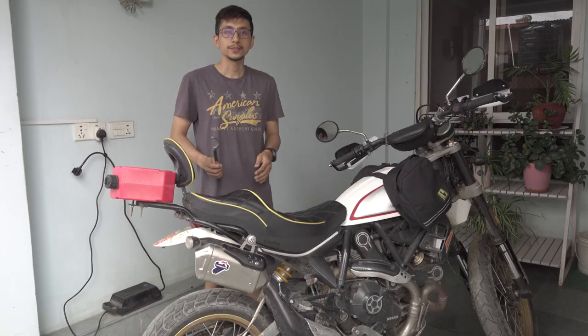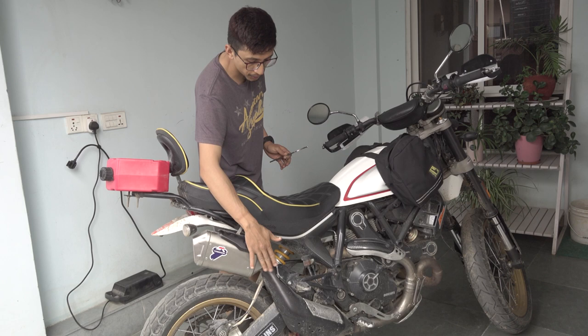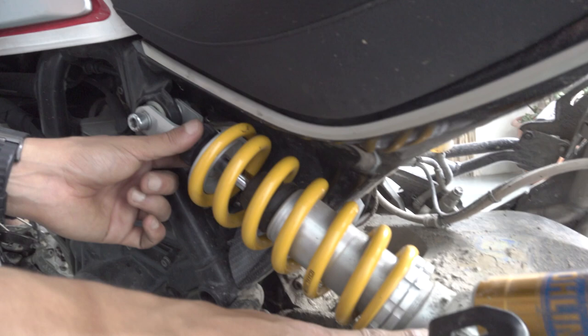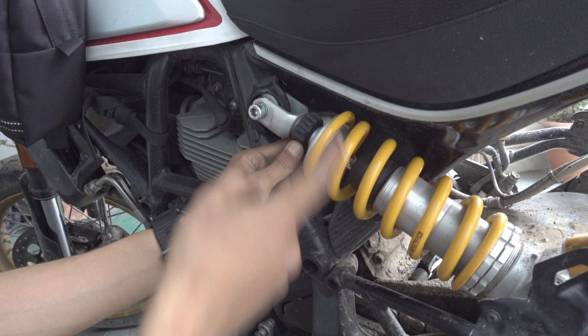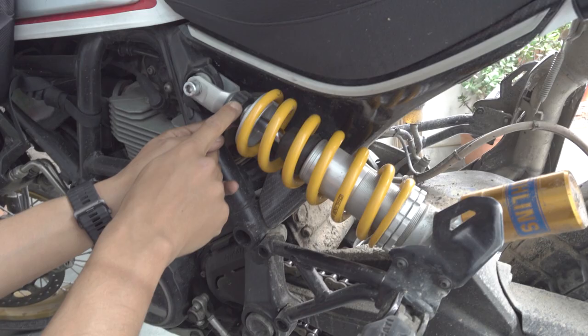The preload is set for this bike with the rider and the pillion. If you're riding alone, set it with just your weight; if you're riding two-up, include your pillion, luggage, and fuel. Now that we have adjusted the preload, it comes to rebound adjustment. Once the preload has been set, we do the same thing for rebound. This is the rebound adjuster and this is the compression adjuster. For compression I need to go for a ride, but rebound is something you can fix with the bike in a static position. Rebound damping controls how much damping occurs when the compressed spring releases.